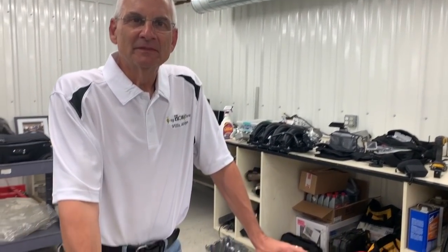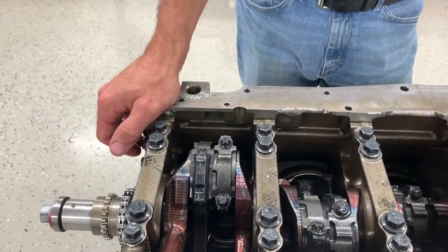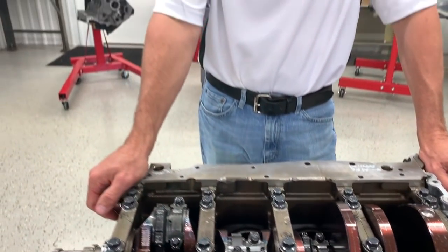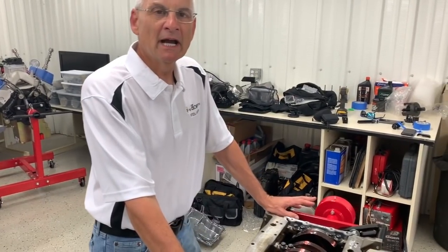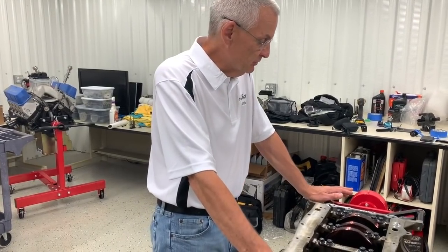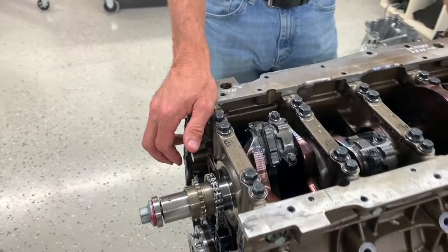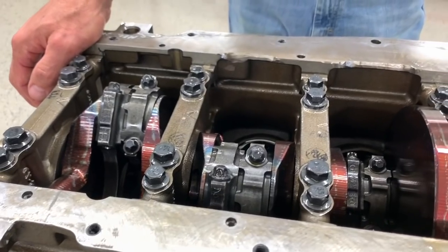With the pan off, it's a really robust setup — six-bolt mains and a forged crank. As far as handling boost: six-bolt mains and a forged crank really speak for themselves. It's going to be really good for most reasonable boost levels for street guys and racers. Brian plans to run one of these on a stock block as an ultra street motor.